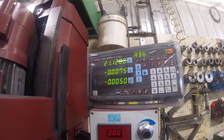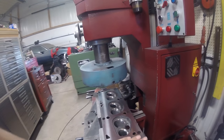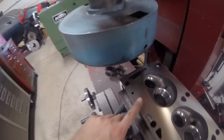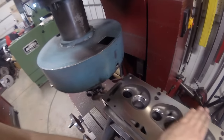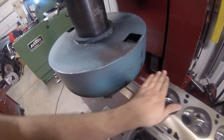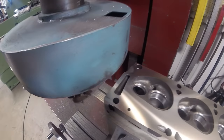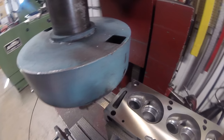We've got a total of five thousandths taken off this head and we've got a real nice surface finish that we're confident is going to hold that head gasket. On the second head I've got two and a half thousandths off and it's pretty well cleaned up with the exception of one corner - I'm assuming this was done on a machine not as stout as this one so the corner is just a little lower. Now I'm sitting at five thousandths off that surface and everything is cleaned up except one little spot that's well outside anything that needs to seal, so we'll call it good.